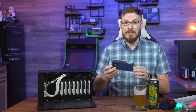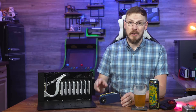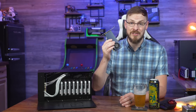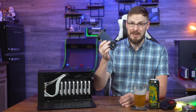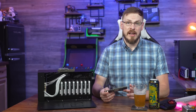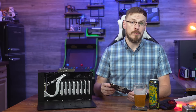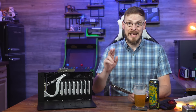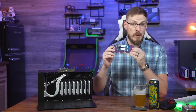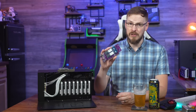I'm actually planning on running this Intel A310 card from Sparkle, which will give me AV1 and HEVC hardware encoding. The smart money used to be on old Nvidia Quadro cards for encoding work, but the A310 from Intel has the same Quick Sync engine as their high-end GPUs, and it's just $100 brand new — a pretty solid deal if you do any video-heavy services. However, I did run into one potential issue with the X16 slot on this particular motherboard: while it does support bifurcation, it will only support dual X8 lanes or a single X8 and two X4s. That means quad NVMe adapters would be a no-go on this particular board.